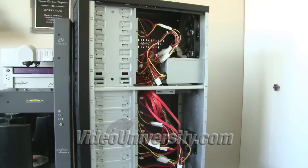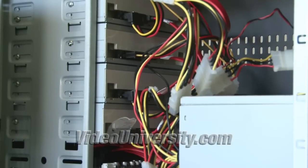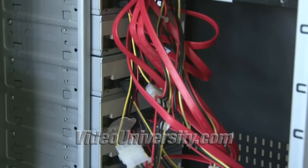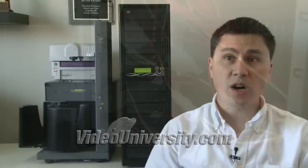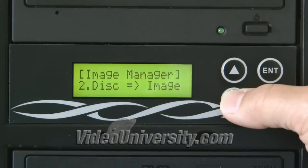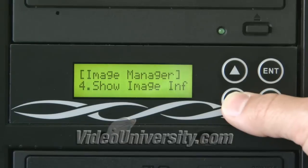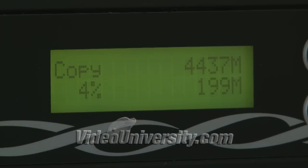Thank goodness for the smaller serial ATA cables. So what is the point of the hard drive? The controller card uses system-on-chip technology and doesn't require a hard drive — the hard drive is optional and is one of the two ways you can duplicate a disc. The other is disc-to-disc. To use the hard drive, you load a master and copy the image to a hard drive partition. Once you put the disc in the source drive it is a one-button function to load. The front of the controller card has four buttons and a small LCD screen, and navigation is pretty straightforward. Although there are 12 root menus, most everything is done through three of them. Number 12 is the image manager where you load DVD images onto a partition and assign a name. Number 8 is the select source function where you decide whether to copy from a DVD source or from an image on the hard drive. And number 1 is the copy menu — when selected it serves as the start button to commence DVD duplication.